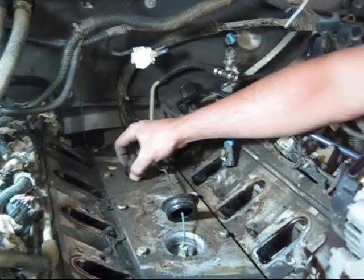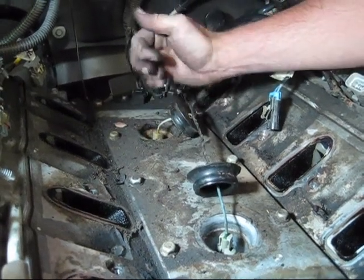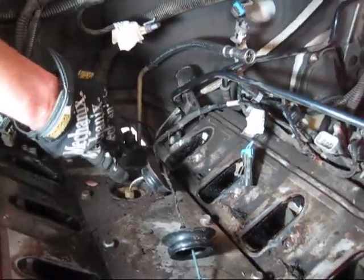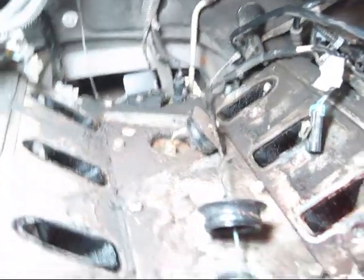So looks good. All right, so this is our first look at the knock sensors and pulling these rubber boots off. And you know, the engine's a little bit dirty, but we don't see really too much wet stuff. Ooh, I see maybe a problem. This wire back here, it almost looks like it might be broken right here. There's also, it looks like some corrosion down in there. Yeah, really. Like it's got wet.